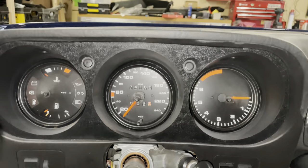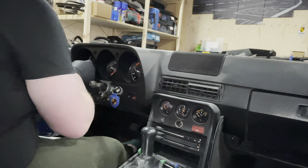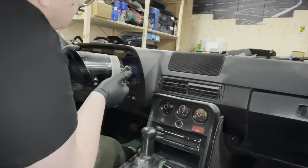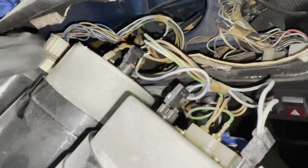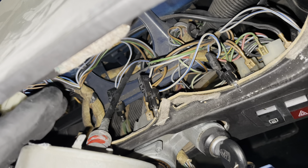Next we're removing these two Phillips head screws so I can pull the binnacle out and remove the gauges from the housing. Now that the binnacle is just resting on the steering column, we can unplug it — remember where the cables come from. There's a lot of memory in these cables so they tend to go back to the right spot, but it's good to make sure you understand where everything came from. Now with all cables disconnected, the last thing is to disconnect the speedometer cable — it can be a little tight so grab a pair of pliers to loosen it and then it comes off.